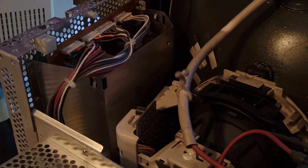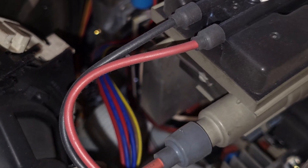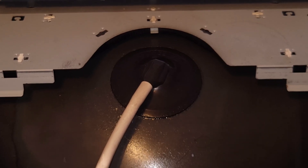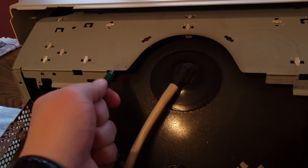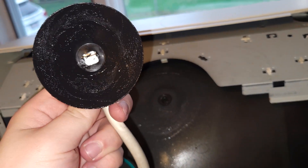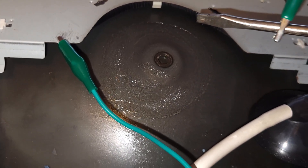When you take that off, I'm gonna dump that in the little case right there. It's a very beautiful-looking monitor. We've got cables on the flyback deflection board and all that stuff, and there's our power supply. That's our funny anode cap. I'm gonna discharge it right now — I'm gonna put a thing on my little flathead. And I know it's scary, but watch this — I'm gonna pull it off. And wow, I didn't actually die. Amazing.